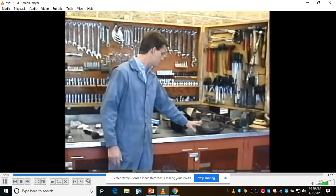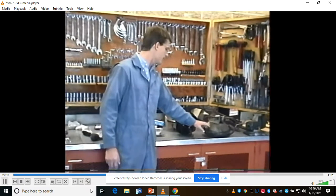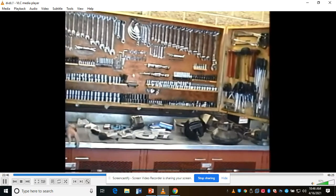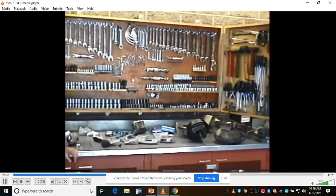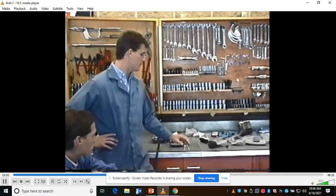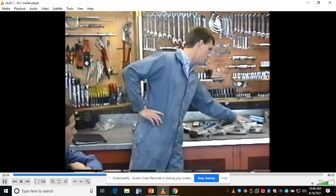Anyway, that's a brand new one. Those things wear out. Power brake boosters, the diaphragm will eventually crack and get holes and so on. So there's a lot of things that can go on. If you spend $250 in the junkyard, you may not be getting such a hot deal. This stuff, of course, these are used and they don't wear.